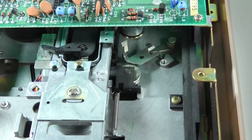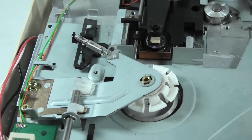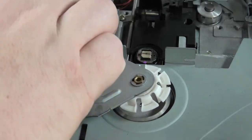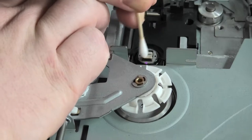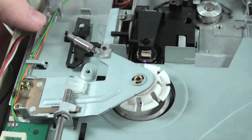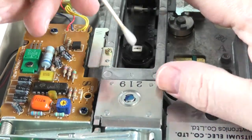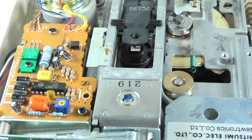All right, that's clean. I love the 1541-2 drives. They don't always work on copy protected discs, but same thing. They're easier to get to. You can see how this head really flips up really easy. Then I get in here, clean this off. That's this model. Same way with this one. Get in here. You can see how easy this is. What, this takes like 5 seconds. If you're like me and you keep the lids off, literally 5 seconds to clean read-write heads.